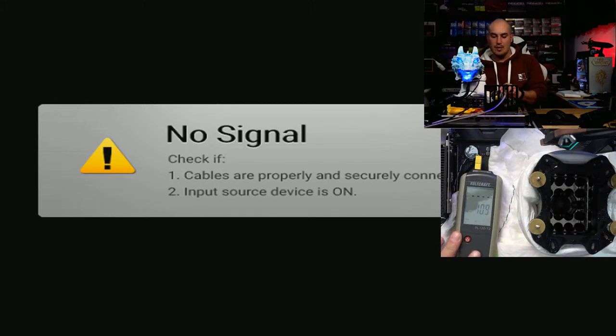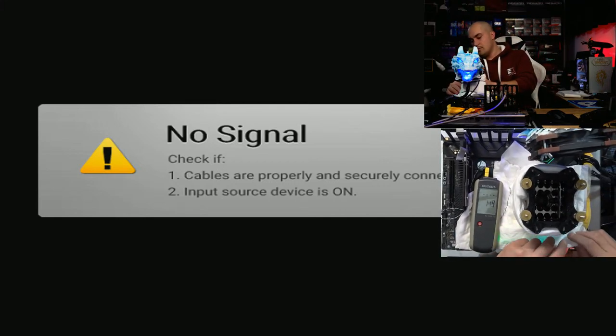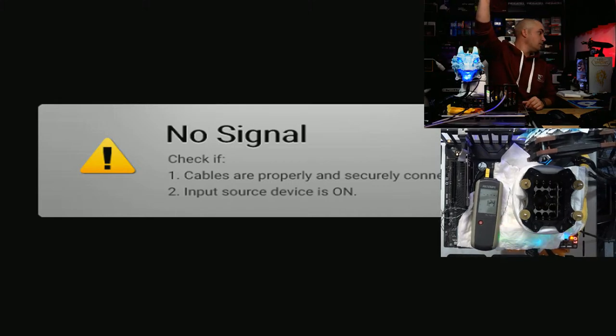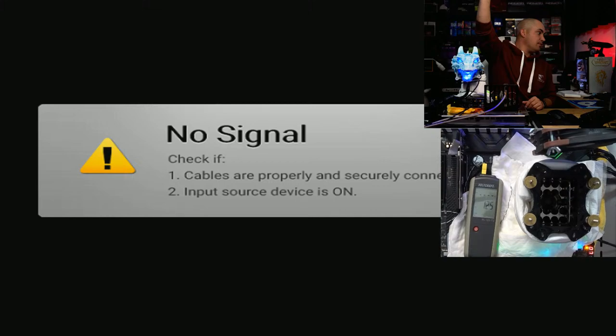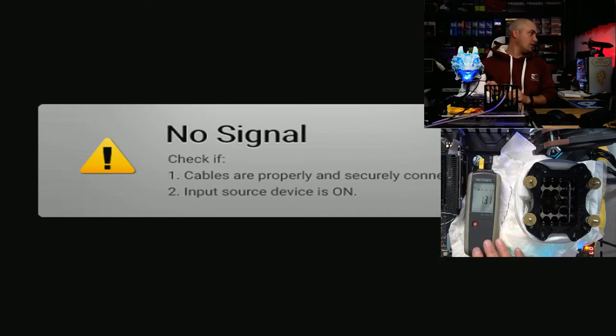Sometimes BIOS are really, really bad. We have another issue now. That is unusual. Let's see if I can show you some error codes. Here we have the 21. Never have a 21. So this is completely random. 007 usually is FCLK issues. So, well, I'll fix that later.